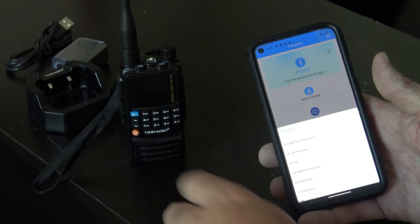Going into Functions you can set squelch level, voice prompt on or off, priority, roger beep — keep that off on ham radio please unless you're on FRS or in the woods somewhere. There's mic gain, stun and kill, power-on message. When you're all done, you hit Write and it writes right to the radio. It's that simple — I really like this radio.